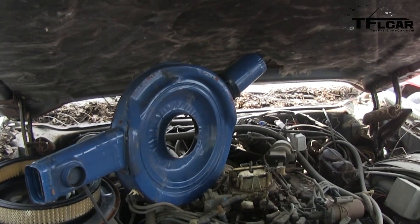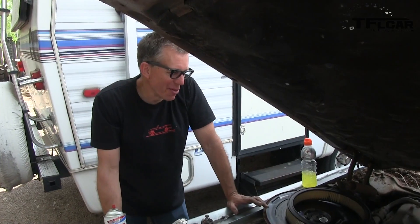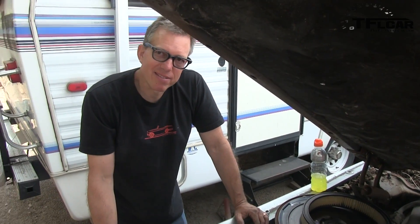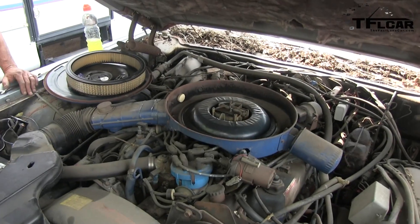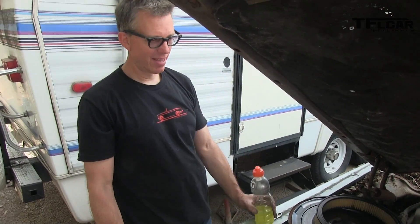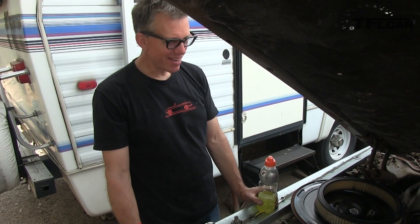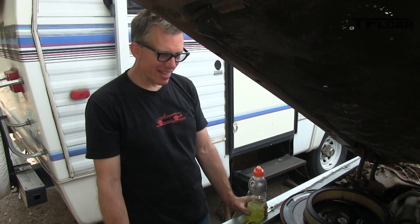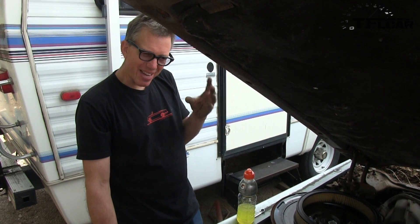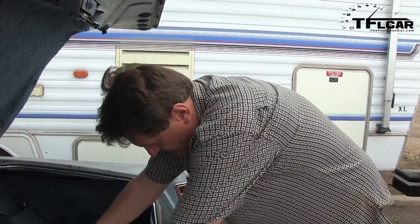It's coming up to the carburetor but the little float needle - oh, it could be stuck. So I'm going to try and just unstick it with the compressed air. It's possible that with the old fuel now flowing into it, we've just doused it and flooded it. You never know if it's flooded or not flooded with the carburetor - it's hard to know. If it would just spit and give a little sense of running then you could tell if it's starving or flooded, but when you've got nothing, you just don't know.